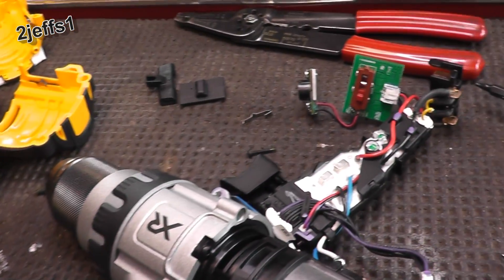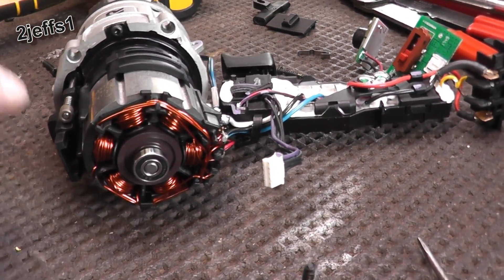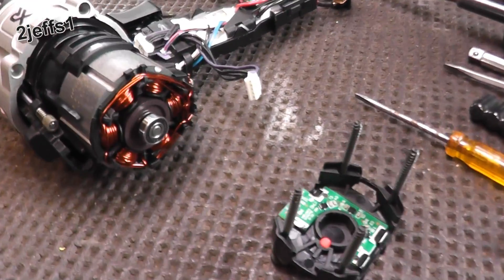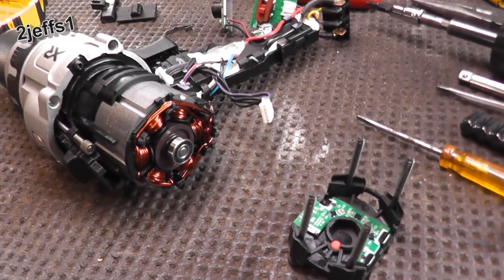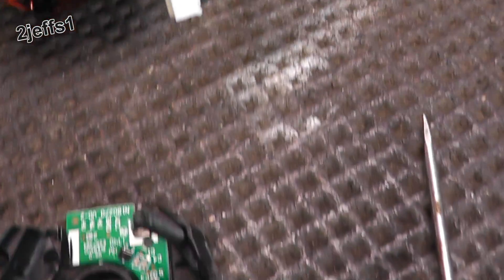You've got some technology nowadays — it's actually a brushless motor. It's a three-phase motor, so you have three leads going into it. What they do is change DC to AC, then convert and modulate the frequency of the current going through the motor to vary the speed. Now we know the rest of the story. You might want to see this reassembly too — I bet some of you folks knew I was going to take this thing apart. Hopefully I can get it back together.